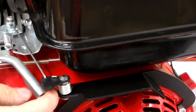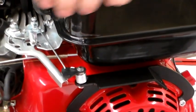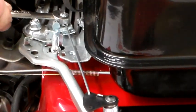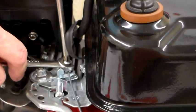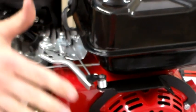Now take the arm and make sure everything's working — we don't have any bind, no problems, everything seems to be fine. Take a 10 millimeter wrench, hold that nut, and then lock this screw in place. That's it — throttle's working.